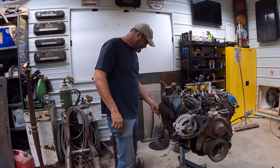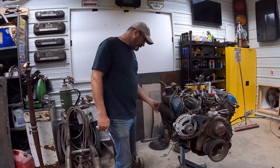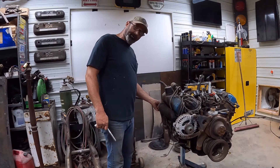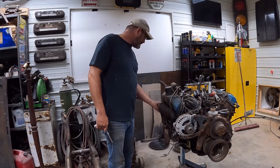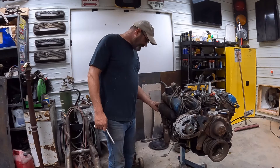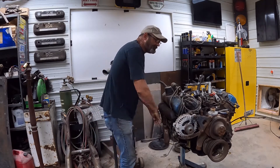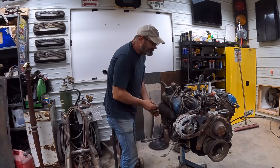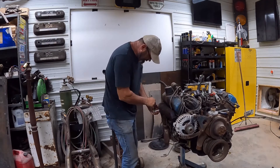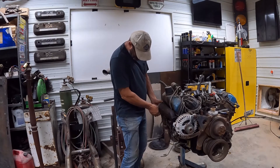I think we'll run this thing the first time on that Therma-Quad that is on it. We'll leave the stock air cleaner on it, stock timing, then pull the air cleaner off with the Therma-Quad still on and play with the timing - see if we can make it run a little better. It does have the transmission behind it with a shift kit, 2,500 stall, four-elevens and a posi in the chassis. It would be interesting seeing what this old 440 makes compared to the 360 that used to be in it - with stock air cleaner and stock intake - doing it little by little. But I'm an old car geek, you know.